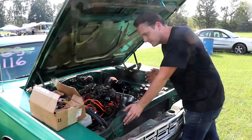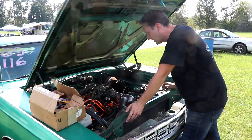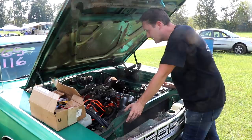On that last pass, I was really noticing at the top of first gear, I mean, you can see in the video, it's really blowing out some white smoke. I think it's getting really lean on the top end, and I can actually hear the valve rattling just a little bit, so I think that I've got her just a little bit too lean, meaning that I can back off the timing just a smidge to kind of help that out.